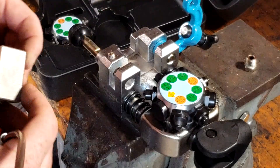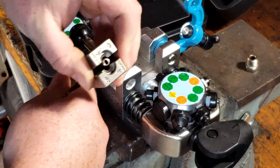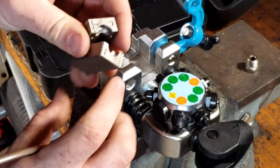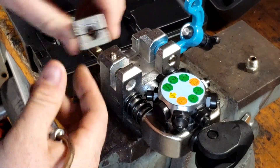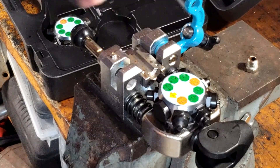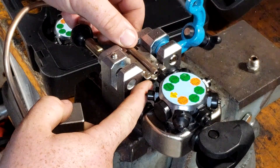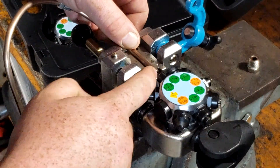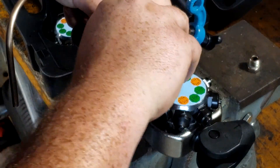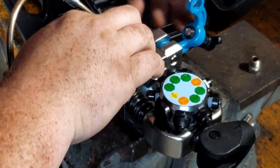This kit has multiple dies. We're going to find out exactly what size our pipe is — in this case it's a quarter inch. These have two different sizes: a 45-degree and a flat. We're going to go 45, so that's the flare we're going to do. We're going to do a double flare. We're going to make sure that our end is just a little past what the die is.